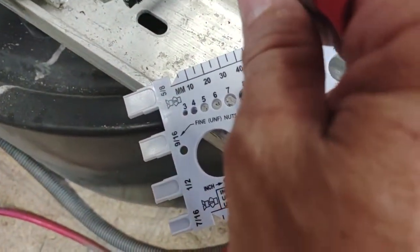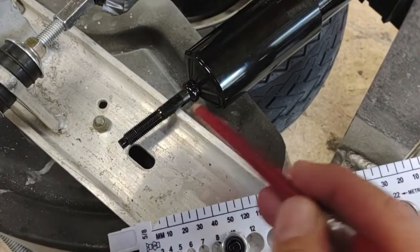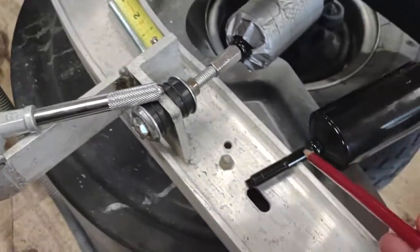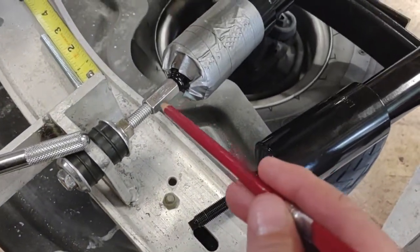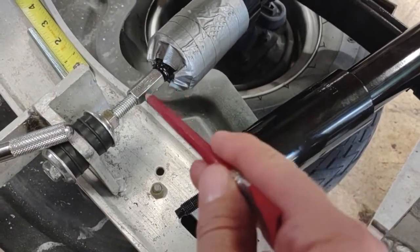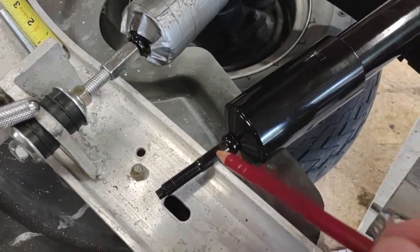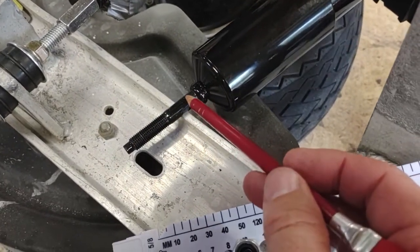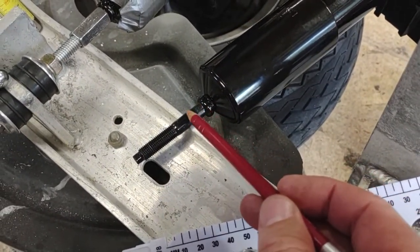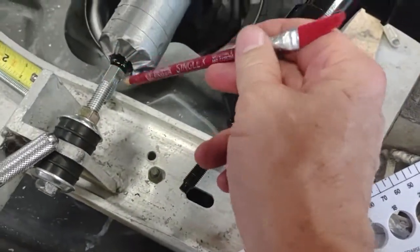So you'll have no black showing, and it wasn't too hard to get it done by hand. I cut it off here to get things started, threaded it on, so this whole area was threaded. Then I measured what I needed to hit for half of this coupler. This one happens to be stainless — it's the only one they had in coarse thread at Ace. Ace has great fasteners. So I went a half inch in so that I would go half engaged on this side, and then the other half will engage into the other side.